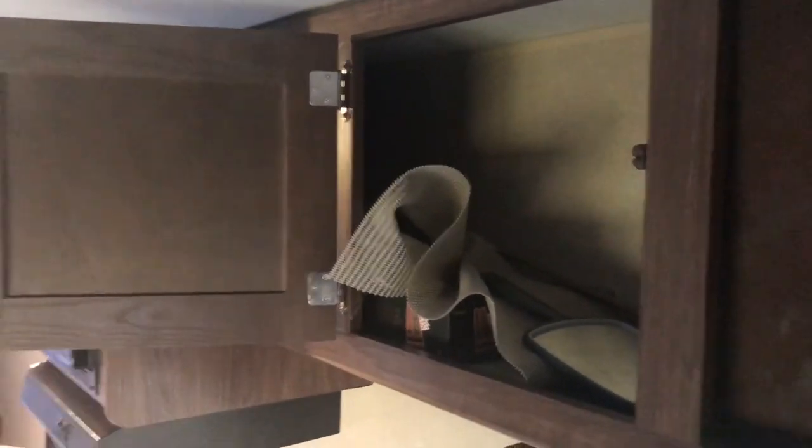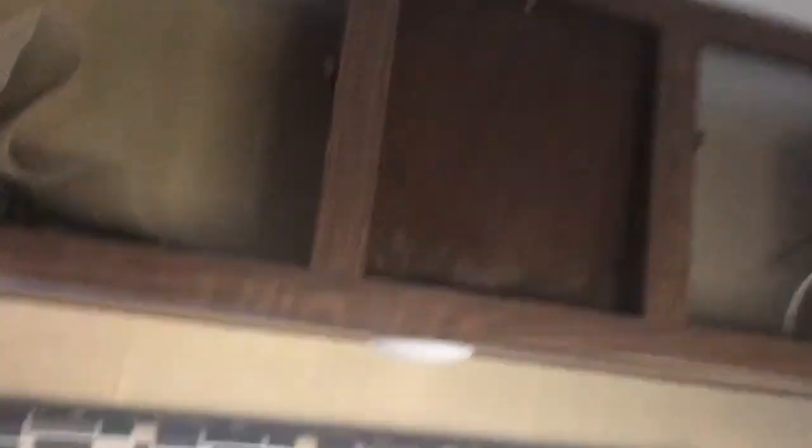I got a 15 by 15 inch square of half-inch plywood and I'm going to screw it into the back of there. I got some fender washers to distribute the load throughout the wood as I'm mounting it. In the back I've added a lip, and what that lip is going to do is set against the actual piece of wood holding these cabinets to the camper — extra stability. So we're going to mount this and screw it in.